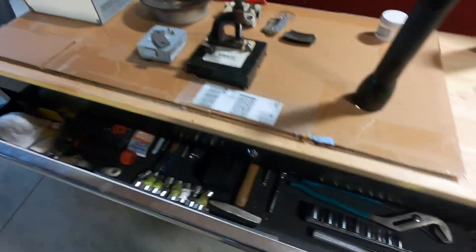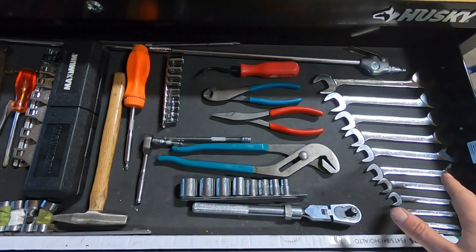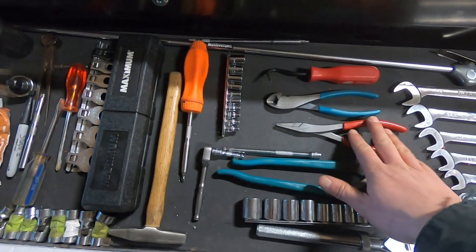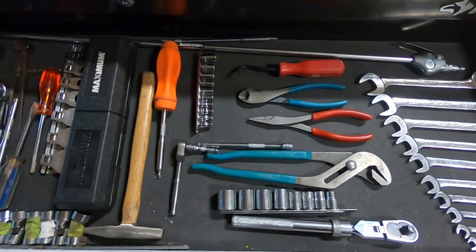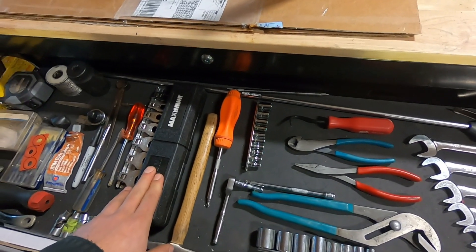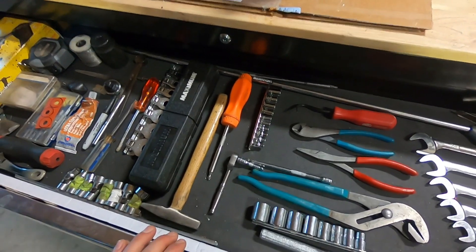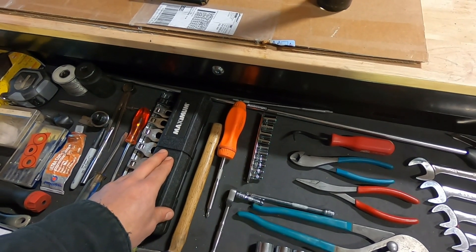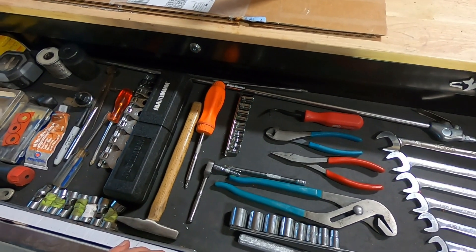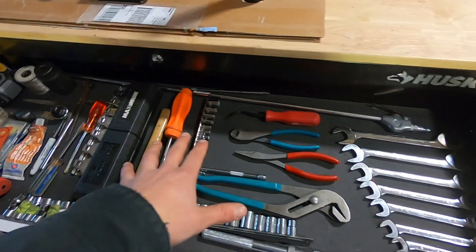Tool-wise, we're basically going to need some basic hand tools for the job today. We'll need a few different sizes of wrenches but nothing outside of your standard kit. We'll need to be able to pull and remove some cotter pins — these are the three tools I normally use for doing those. We will need a torque wrench as well for putting the wheel halves back together, and remember, especially if you're working on a certified aircraft, that torque wrench needs to be calibrated annually. We also need a screwdriver and a couple of sockets.